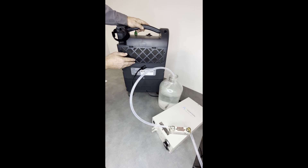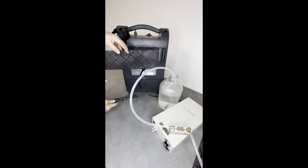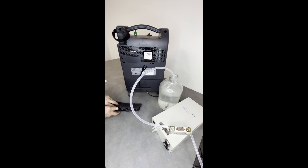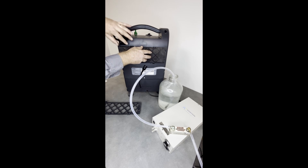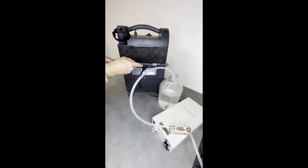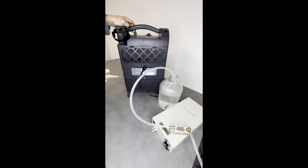This filter here is cleaning out dust and so on from the air — it needs to be changed from time to time depending on conditions. Push those little tabs down and this filter will come out. It's one you can shake outside to remove the dust, then wash it and return it once it's dry. There's also another finer mesh filter that pulls out — replacement filters are available. It just pushes back on the fitting, clips on the bottom, and snaps back in. If you don't change it, you get more restriction, less cooling, and the motor overheats.